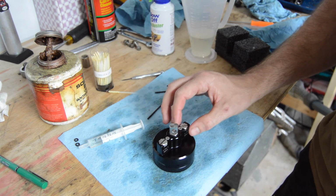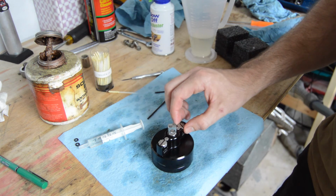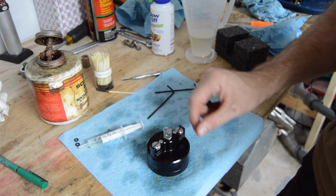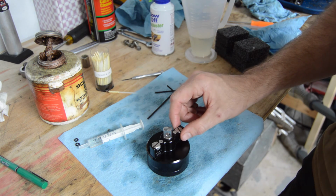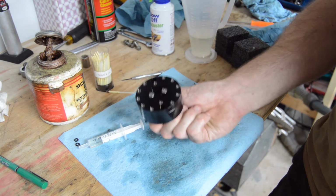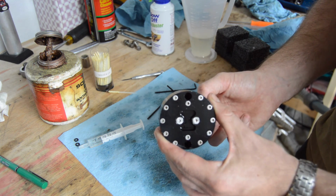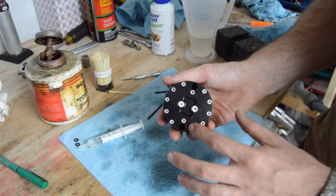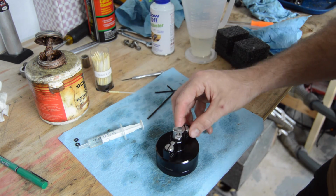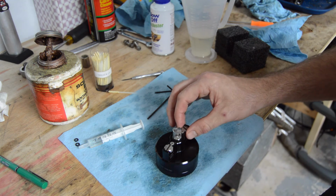So, other situation, what if you tighten this all the way down, what if you tighten to the point in which you reach that pressure feedback, and then you count more than one full rotation of the screw until it bottoms out? Well, that's going to indicate having too much fluid. So what you will then need to do is move the screw to the point in which you feel the pressure feedback, turn the damper over, break the seal on one of these flathead screws, and turn the adjustment screw in just a little bit to let out some fluid. And then, of course, retighten that flathead screw. And then from there, you're going to repeat the test to ensure that you are, in fact, within 1/4 to a full turn from bottoming out at the pressure point.